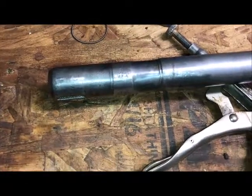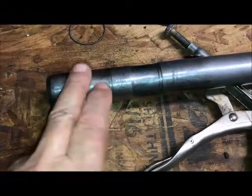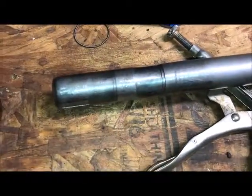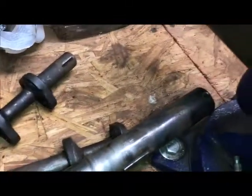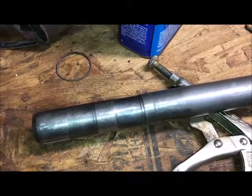But that's the brake side. The clutch side was over here. So they didn't ride the clutch much, but they did ride that left-hand brake, to spin it at the end of the row, I guess. The right-hand side doesn't show that much wear, so my guess is this guy liked to make left turns and did a lot of them.